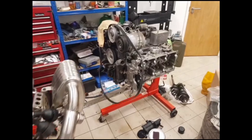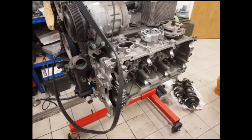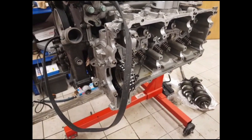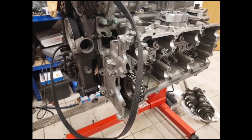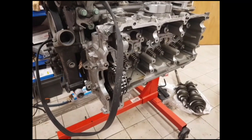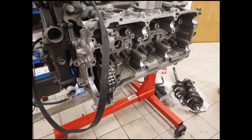This particular system is required because on a flat-6 engine, or on any flat engine, the oil which gets to the heads is pumped up by the oil pump. On a normal inline-four or V engine the oil can easily drain back to the sump, but on these engines some of it can't, so it sits in the heads and must be pumped back to the sump.